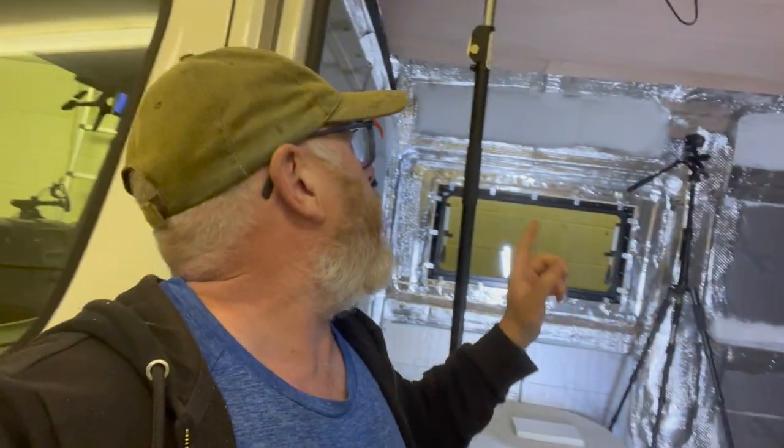First I've got to figure out using these support poles with some kind of ply batten to go across, so that when I stick it up I've got something that fully supports the layer all over with no sagging between panel joints. There's a little strip that you basically staple to the ply, and that strip has a little cap that goes on it. Once you finish the ceiling you pop the cap on and it seals it all off. The sides are pretty much prepped to go on - we'll need to cut out for the window, but that panel depends on all these being installed.